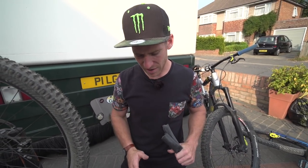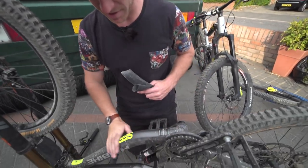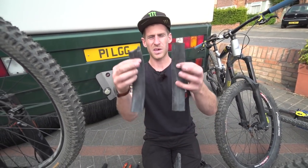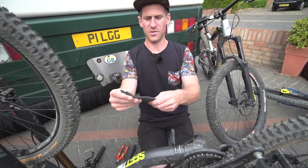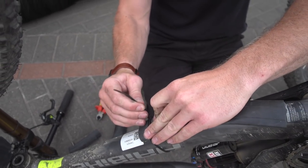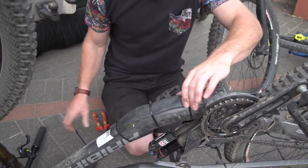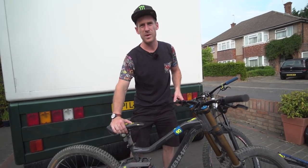Number nine is for you downhill guys and basically anyone that does extreme stuff on a mountain bike. When you're being extreme and crazy, stones are going to hit the underside of your frame. If you're looking to sell your bike after the year, having scratches is not going to help the sale. Cut two pieces of inner tube like that and thread them through like this so you've got a really thick piece of rubber. Place that on the frame and simply wrap your frame with a cable tie. That protection pad is literally going to save your bike — it'll stop so many dents and scratches and you'll be able to sell your bike for a lot more money.